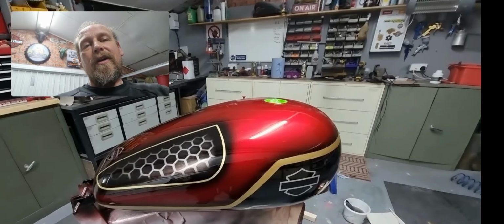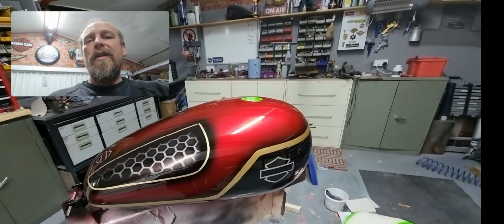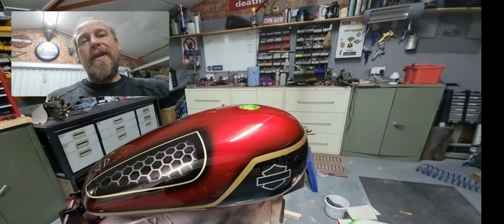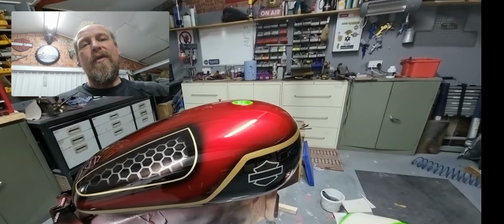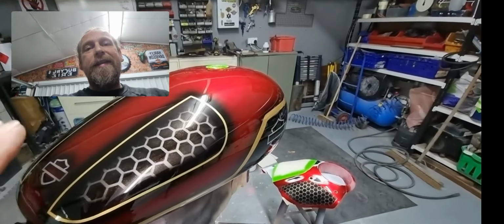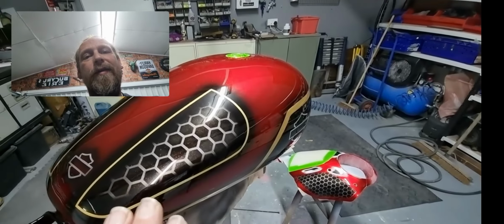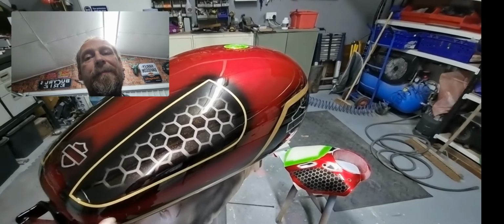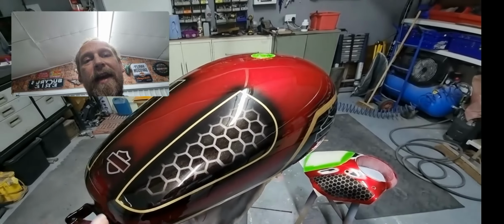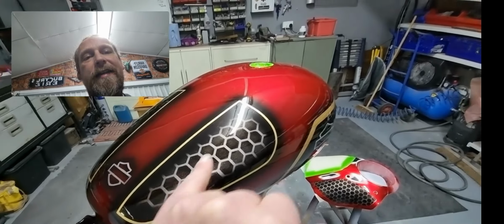So by putting the clear coat on, you're protecting the paint and what you've done underneath before you flat that down, using anything from 800 to 1000 grit to finish before you carry on any more work. So again, this one has been done 3 times to get rid of all the ridge lines along here before we've carried on with the process. So again, a little bit of a thicker line around here, around about 10 millimeter, 3 mil line tape.